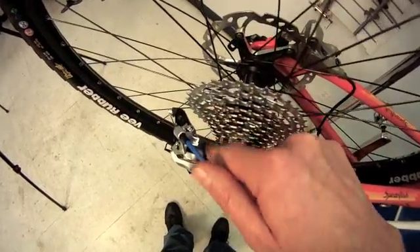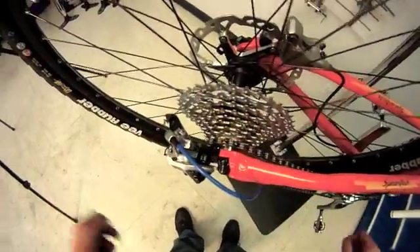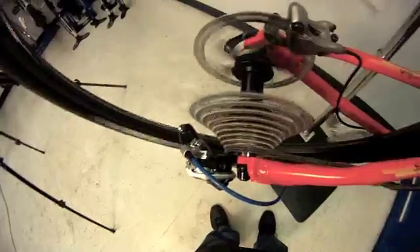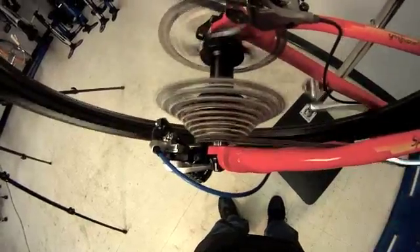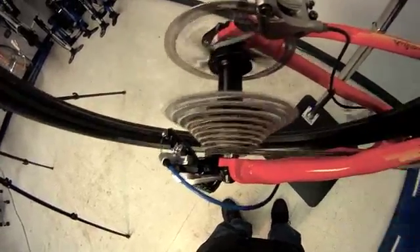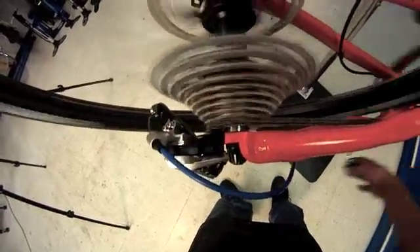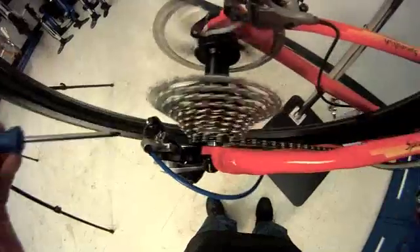The H screw here has positioned the cog underneath the sprocket. And this one's actually set pretty good, but we should try it in two extremes and see how it sounds. What we have here is what I would call the ambient sound of the chain — the steel chain meshing on the cog. Let's give a listen to this little symphony here. Okay, that's the normal sound.